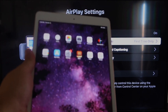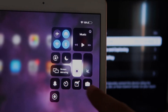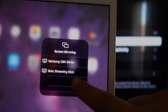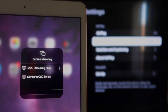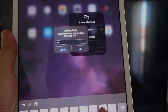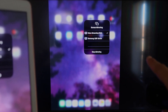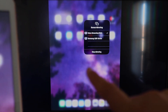Now go to your iPad. On the top right corner, swipe down to bring up the menu, and you'll see Screen Mirroring — tap on that. Right away it shows available devices; tap on Roku Streaming Stick. It'll ask for the code displayed on the TV — mine was 3393 — enter it and click OK. Once connected with a checkmark, it will mirror exactly what's on your iPad to your TV. To stop mirroring, tap the Stop Mirroring button on your iPad.